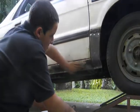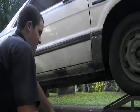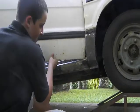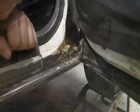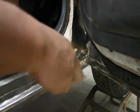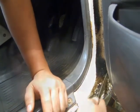We just finished wire brushing the patches that we put on yesterday with these Brumby discs. They're just like big wire brush discs. They really rip it up, and some of the tight spots that we can't reach, like in here, we're just going to get off with some paint stripper. Already paint left on the brush. Just finishing up the last parts of cleaning up the paint stripper. That really bubbles it up, doesn't it? Yeah. Falls off easy. Yeah. Nice clean steel to feather your bog into.